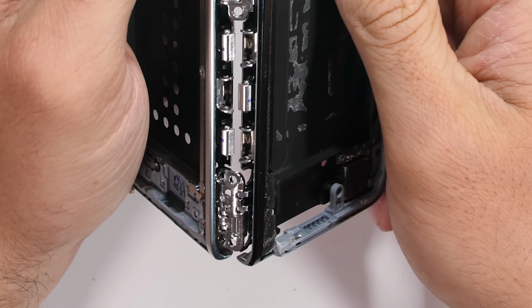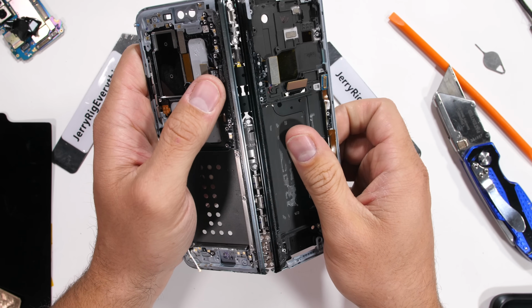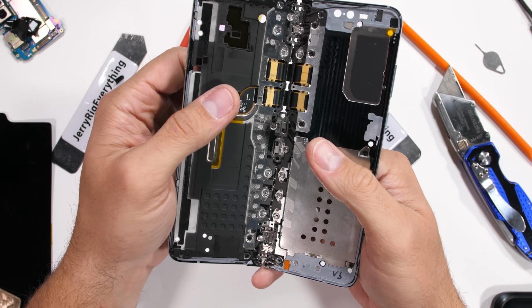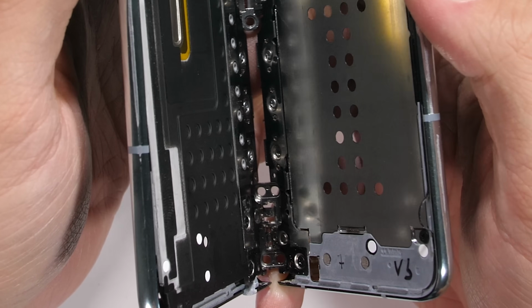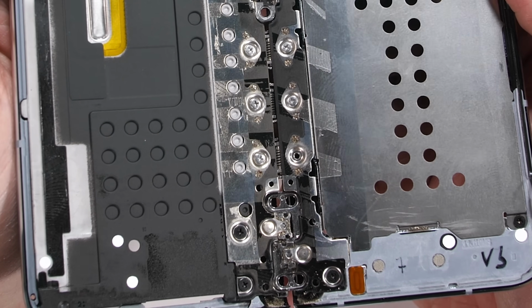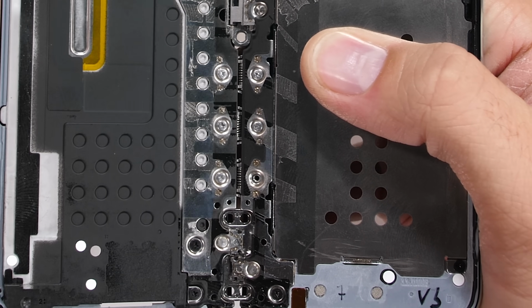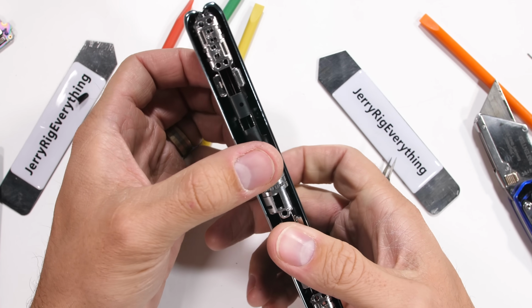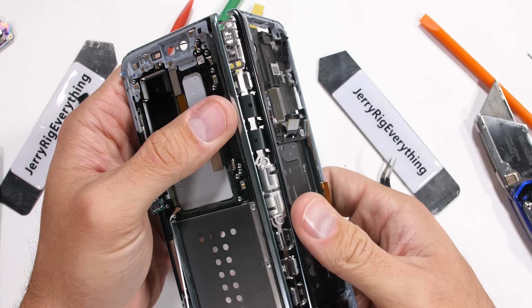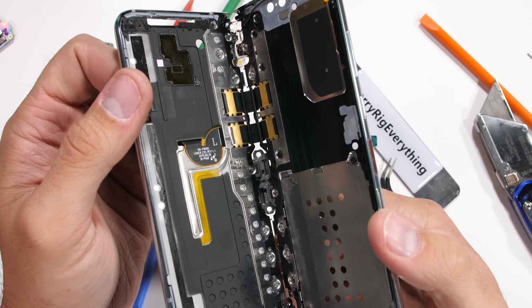But with all the precision that these moving parts require, there's not very much room for any specks of sand, and currently sand and dust can still get inside and grind away to their little heart's content. So while this hinge design was inspired by watch mechanics, hopefully Samsung can also seal it up, like watches are, in future versions of the Fold. I think it's an awesome innovation, and it's good of Samsung to take care of their customers by offering replacement screens for so cheap during that first year. I look forward to seeing what other versions of the Fold come out next.